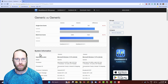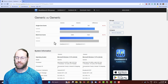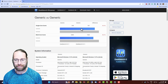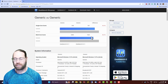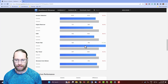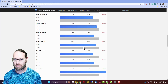Everything installed in the end — it was a bit more trouble than demonstrated in the video, but it's booting. I really do need to reinstall Windows; that installation is kind of reaching the end of its life. Looking at the benchmarks, we can see about a 10-11% improvement in single core and a lot more in multi-core performance. There is one exception: in single core, the photo filter Geekbench test is actually faster on the old CPU, but otherwise it's faster all around.